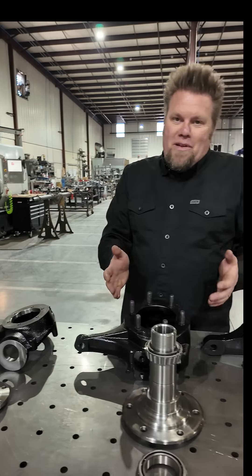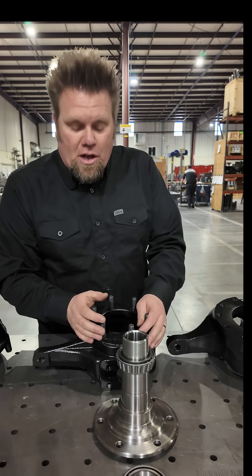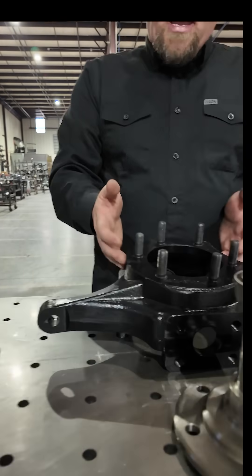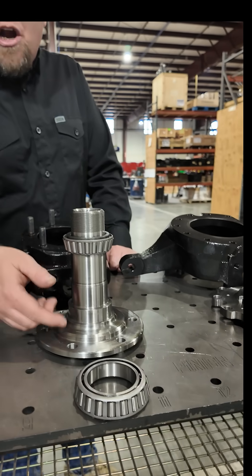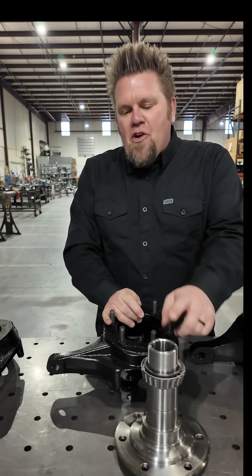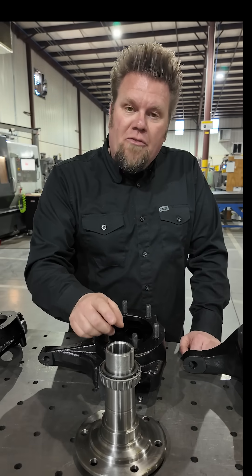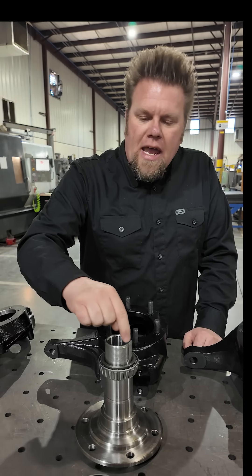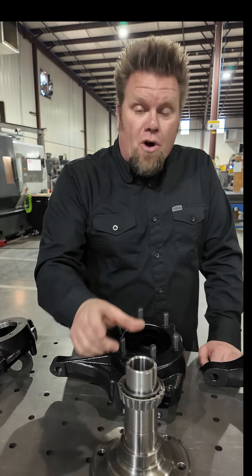The next upgrade that you would probably see most commonly in the off-road space is some type of king pin knuckle. This is a Dana 60 king pin knuckle with a heavy duty spindle. You can see the spindle is bigger, the bearings are bigger, and these were normally offered in some type of 35-spline outer shaft. There were 40-spline upgrades available for this axle, but it meant hogging out this spindle and it can make it so thin that it's more prone to bending.